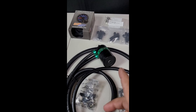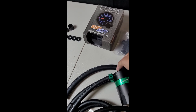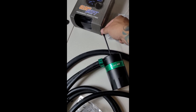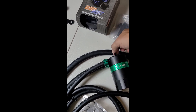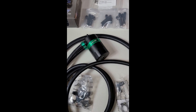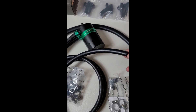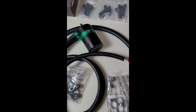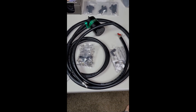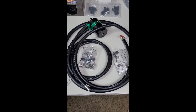We'll eventually hook up a toggled drain port, which will allow us to freely drain the contents caught in the catch can back down to the oil pan, then change our oil. I prefer not to run open all the time and have that stuff recycling back into your oil system. When the catch can fills up, I'll probably run the line directly back down to the oil pan through the stock inlet at the bottom of the dipstick, flush it out, change the oil, and move on.